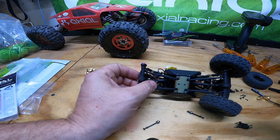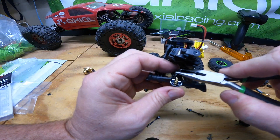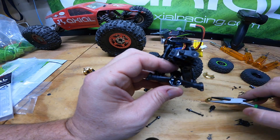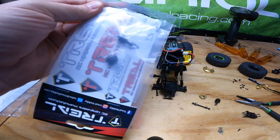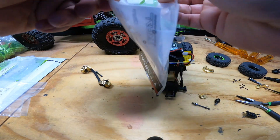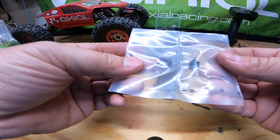Here I am removing the front driveshaft, pulling the pin out, because that all has to be disconnected to pull that worm drive out. That's something I never really mentioned about this vehicle — it is worm drive. I'm not a huge fan of worm drive, but it does things like auto-braking; they don't have to have braking on the ESC with worm drives. The bad part is they're not great for long-term driving — things tend to get hot and it causes a lot more wear. But that's just what they chose to go with.